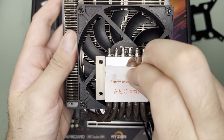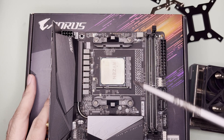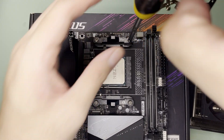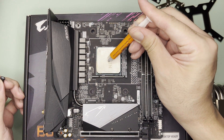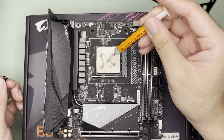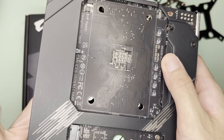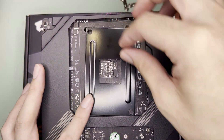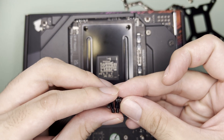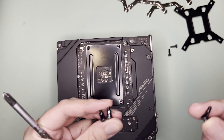The manual did not say how to orient the brackets, but I'm assuming this orientation. Brackets are now installed. Based on the instructions, I have to remove the existing backplate. Next, I apply some thermal paste and try to mount it. Do some acrobatics — turn your motherboard upside down and align the holes. There are two sets of tightening knobs and I'm not sure which to use, so I'll try the taller one first. The taller one appears to be for AM4, and the other is probably for Intel.